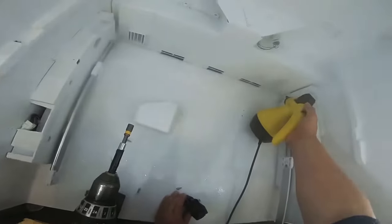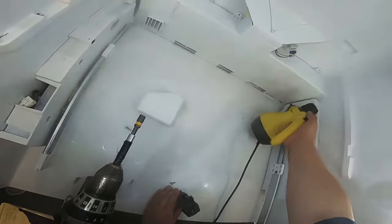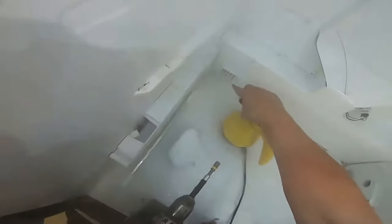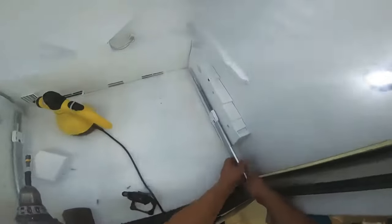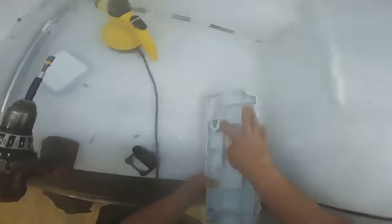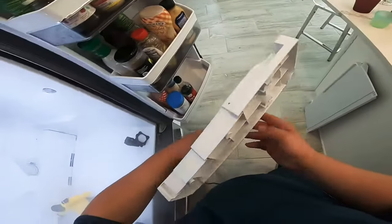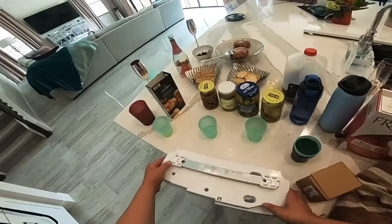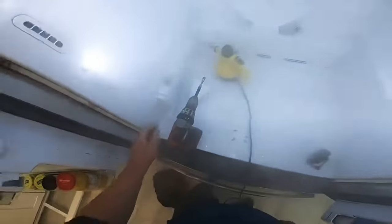Here's the other panel — same thing, one-quarter screw. There's only one screw on the front, though some models may have more than one. In the back there's a male-to-female connection which I'll show you in a moment. As you can see, there's ice attaching the panels together in the back, which is why it's hard to remove them. If you don't own a steamer you can use a hair dryer, but be careful not to apply too much heat or you can melt the plastic cabinet.